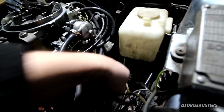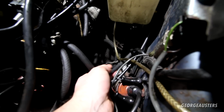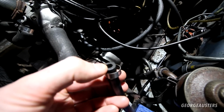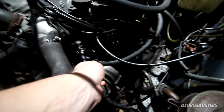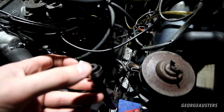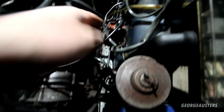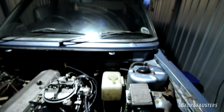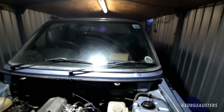We just have to connect this hose. This is for the return. That should go onto there. And we have the inlet. That is there, that will go onto the top of the fuel pump. But right now I'm just going to blow through and hopefully get any crap that's in the lines out, and I'll probably spray some brake cleaner through as well. Spray that all through, that'll all go back into the tank, and then we can drain the tank itself.